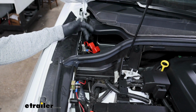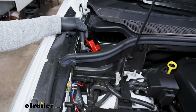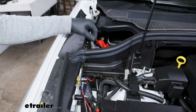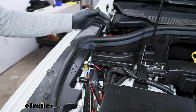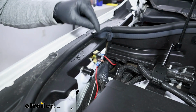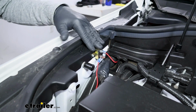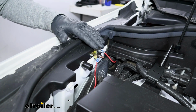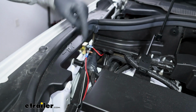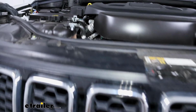The way the kit works is really simple. Power is going to come into your vehicle's power supply. Current is going to feed into here, and this is connected to your battery, and that's how it's going to charge it. Moving towards the front, that wire is going to be connected to a circuit breaker, and this just keeps everything protected. If there's a short or anything like that by chance, the breaker will trip and it's not going to harm your vehicle. But the power is going to come from this wire, which is run down to